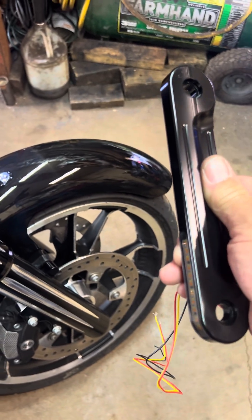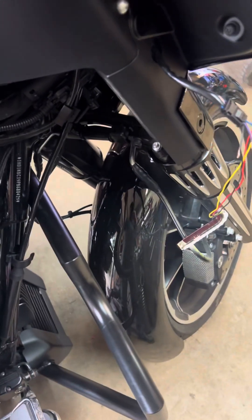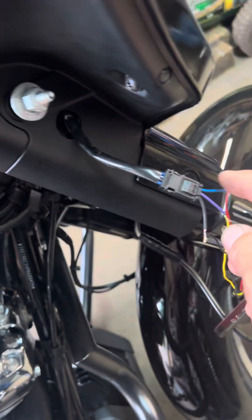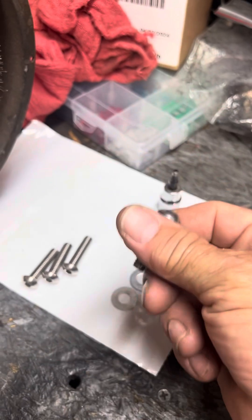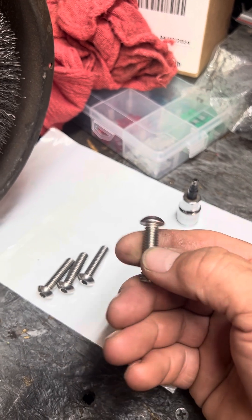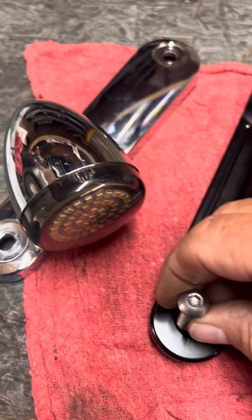As far as bolts, I'll go ahead and tell you this. I had to find bolts. The bolts that go in there are these — they go right in there, and your original assembly goes on that one. With these flush mount style, you don't need that bolt. The bolts you need are 5/16" by 18 thread pitch, and inch and a quarter long will work for these flush mount.